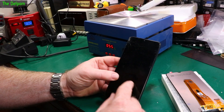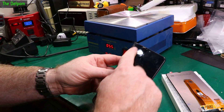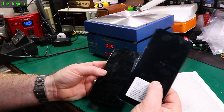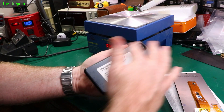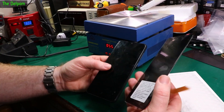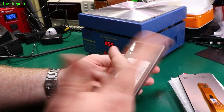Quick little video - I'm going to replace the screen on this Samsung A12. As you can see it's got a broken screen here, and I have a replacement LCD. You can get different versions: you can get just an LCD or you can get one with the frame as well, which means you strip out the internals and fit them to the new frame. That can be easier but it costs a bit more. I just like to do the screen itself.